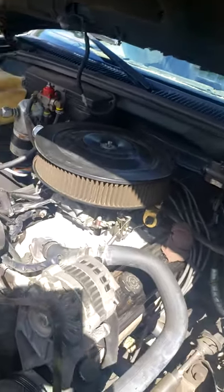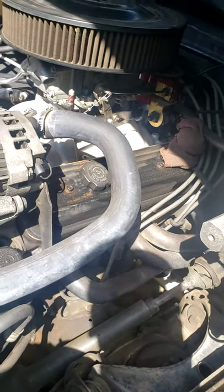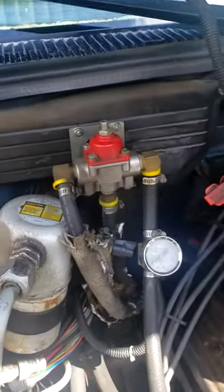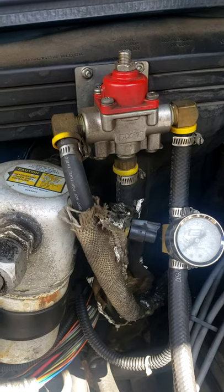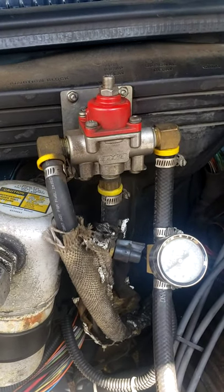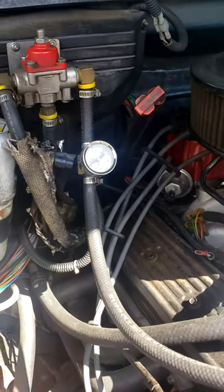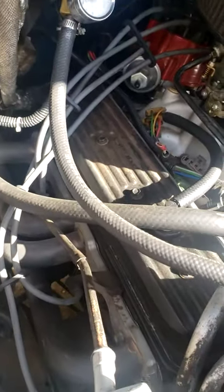What I did was a Vortec head swap off of a '99 Chevrolet Savannah delivery van. It's got a Jiggs Vortec dual plane high-rise intake. I had to add a fuel pressure regulator with the bypass in it because I'm still running my electric fuel pump out of the tank. To keep from doing any damage to the pump I had to add this regulator and route the hoses so I can feed the carburetor, and when the truck is off the unused fuel can return back to the tank.